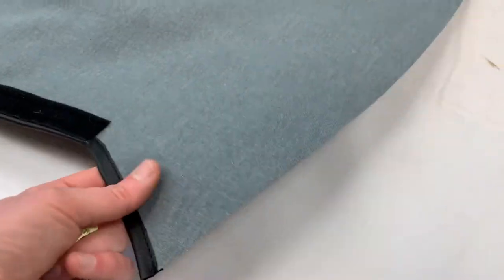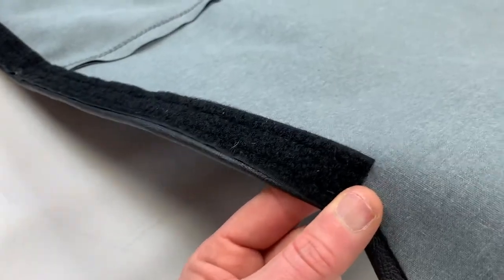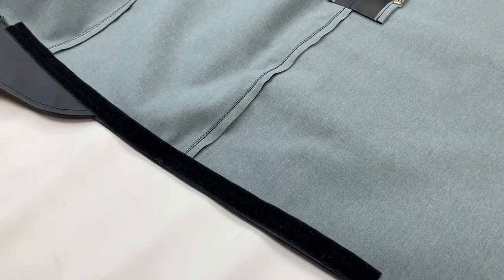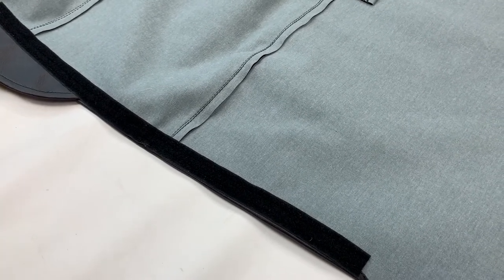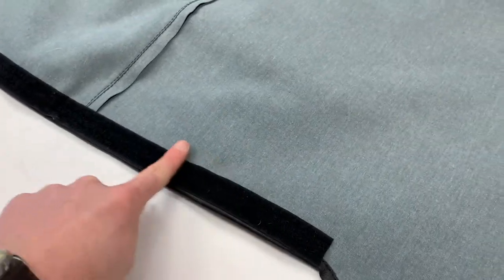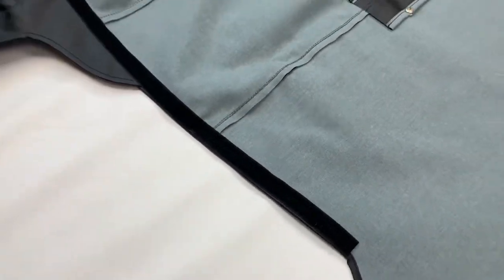The undone edge at the front is the header rail as described before. You've also got velcro on these side channels, and that is because on the TR5, TR250, and TR6s the actual hood frame metalwork had a U-shaped channel with velcro and seals attached to it. So this is the velcro that attaches to the velcro on the hood frame — and that's included as standard.